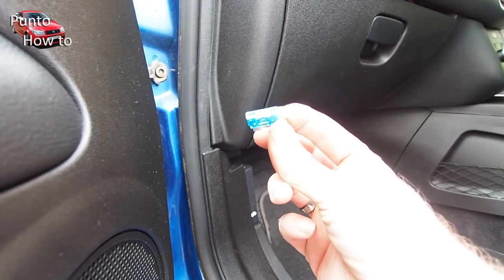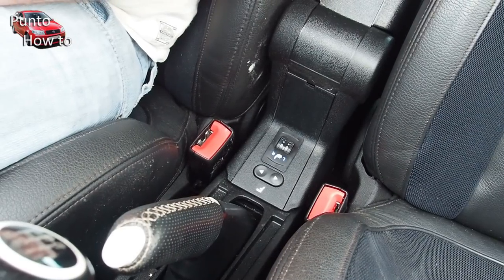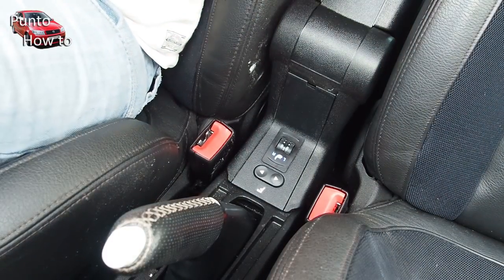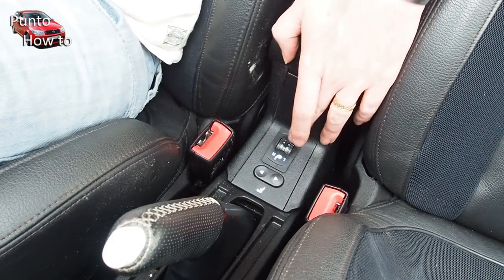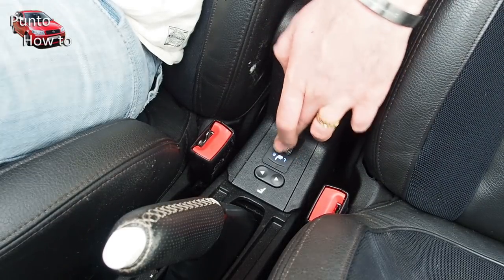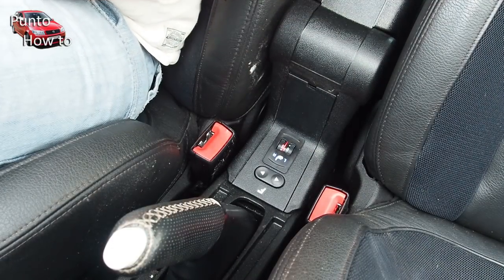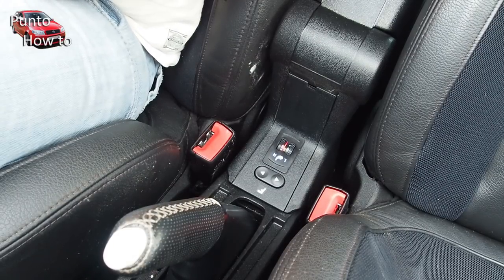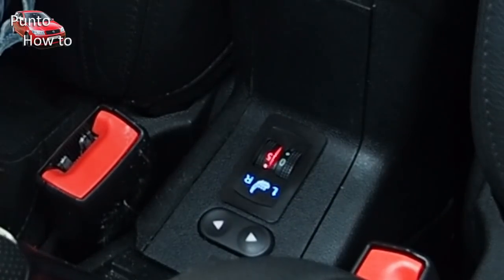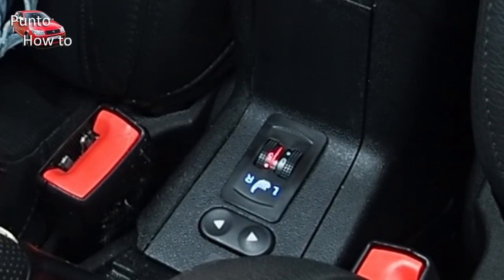Finally, we add a 10 amp fuse to our fuse holder that we installed earlier, and that's it — that's every job tackled. We now have a fully fitted, fully working heated seat system. As you can see, the control is down here between the seats so it's easy to get to, and you just scroll the wheels on either side up and down to set the temperature you want. These are incredibly good seats — they get very hot and I don't think I can really cope with anything above three, even though it goes up to five. The switch lights up blue and the scroll wheels light up red to tell you when they're switched on.